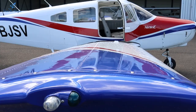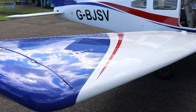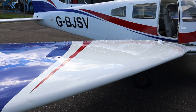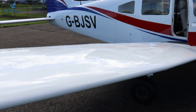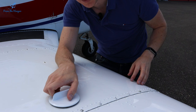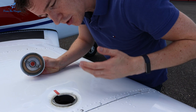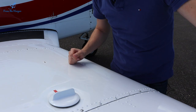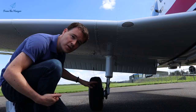At the end of the aileron there's a static wick, which helps the plane discharge static energy it picks up moving through the air or clouds. Walking around the front of the wing, check that it's fully clean — no contamination, no ice, no dents. Check the shape of the wing looks as expected. Then open the fuel tank, look inside, and confirm the fuel level matches what the cockpit indicator showed — just under 10 gallons — so we know the indicator is correct and the fuel cap is on securely.